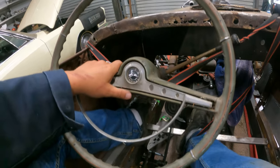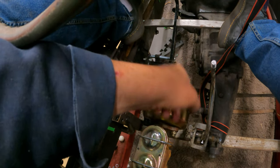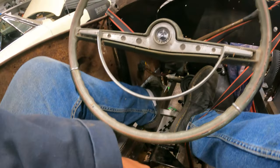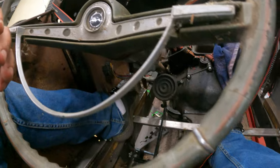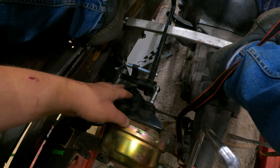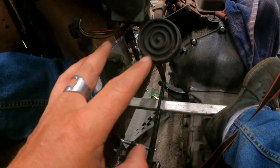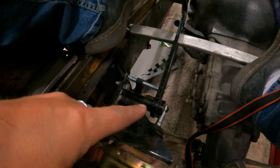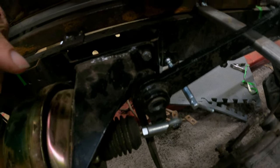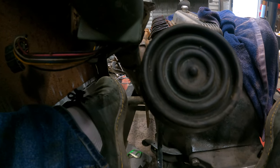It could probably stand to go a little higher, a little steeper of an angle, but we're going to run into the exhaust. This booster assembly clears the shifter and leaves a space for the rods, but I think it puts the pedal assembly in a really inconvenient spot. But if we separate the two, right, if I just cut this part off and then build a pedal assembly bracket that moves everything forward, I think we could still keep everything geometrically lined up for the brake pedal to actuate that lever on the master cylinder. And you can see our clutch Z-bar down there. So we just need a pedal over here that'll mash that.